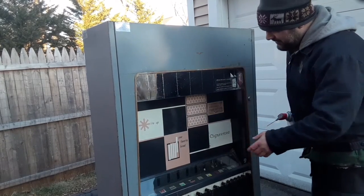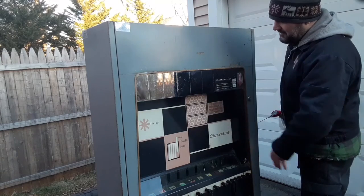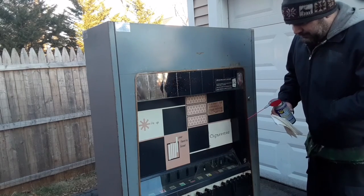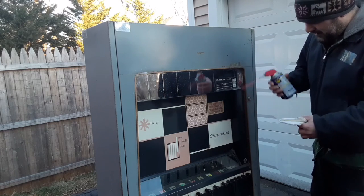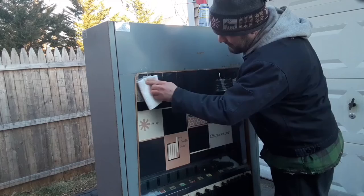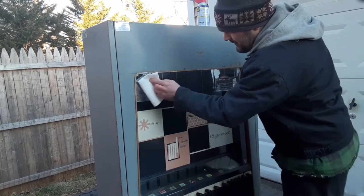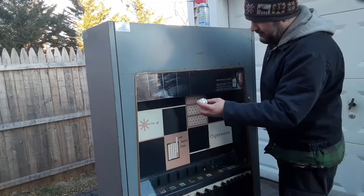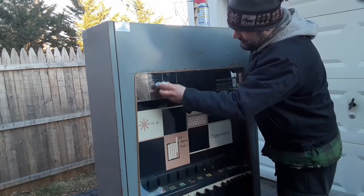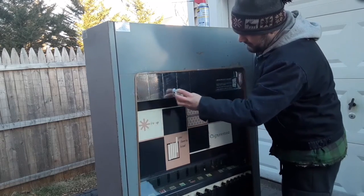I want to redo this chrome one more time. It's coming out nice. There's still a little bit of rust and some pitting. This was disgusting — there was no shine to it, it was all rusty. I got a lot of it off. I just did an old trick we used to do years back. I would never do this on a restoration, but just a car you're trying to shine up, get back on the road, the cheap easy way to do it is with tin foil. I use WD-40 — a lot of people use water. I like the WD-40 first because I feel that it kind of lubricates it. And then you just clean all the rust right off with your foil ball.